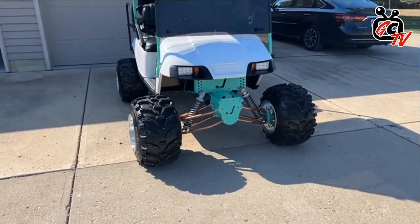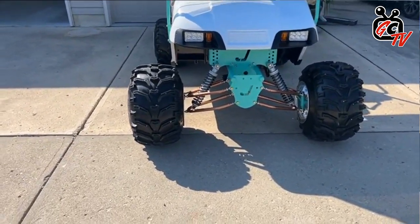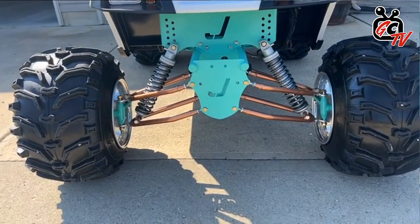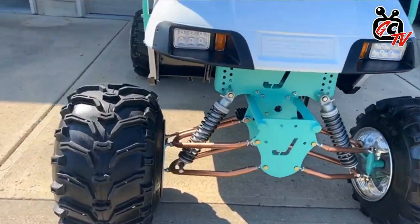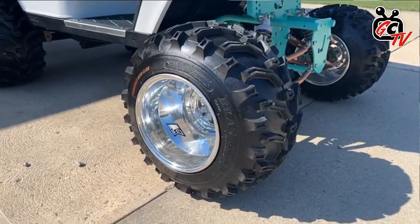So tell us about what you did to make this a one-of-a-kind cart. Give us a little tour, if you will. Yeah, so I guess we'll just kind of start from bottom to top, which is kind of how I built it. I wanted to go just super, super big with the wheels and tires and suspension setup. It's got a Jake's long travel kit on it. I've got it set at about eight or nine inches of lift right now. Custom painted all the A-arms and all the hardware. Wheels and tires — I went with a Kaiser wheel. It's all aluminum. They're 12 by 14s, and then I have them wrapped in 25-inch Kenda Bearclaw tires.